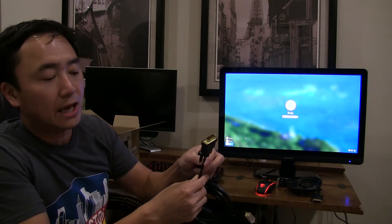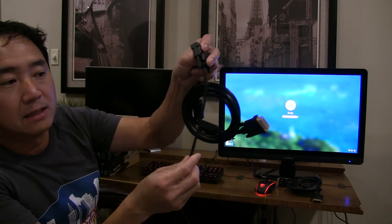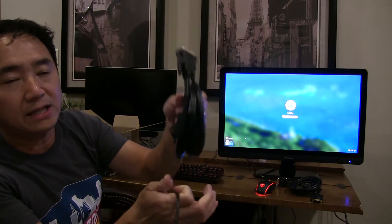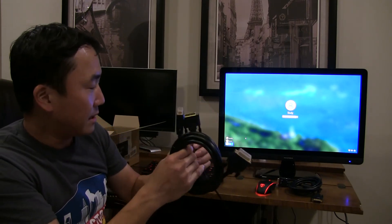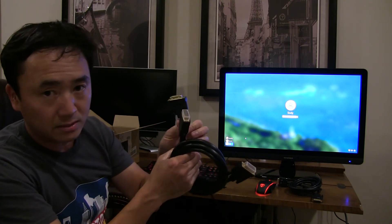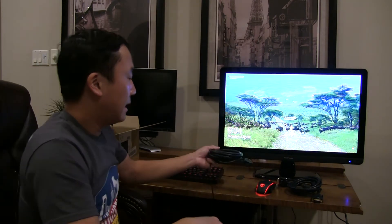You don't realize that not all dual link cables are the same. Look how thin this one is compared to how thick this one is. Some cables cannot handle the high resolution. So sometimes when you get a monitor and it flickers and doesn't display properly, it may be a resolution issue with the cable itself. That's a secret troubleshooting tip that's not easy to find on the internet.